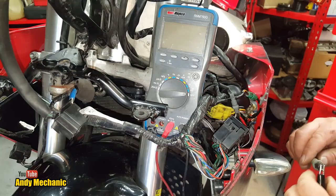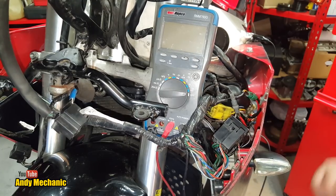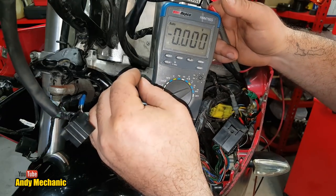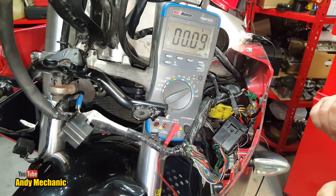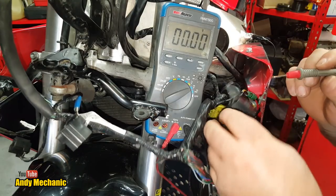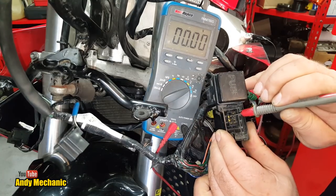Okay, let's get the earth rigged up. Stick it on there, I reckon that's a good place, if you can see that. Pop it in there so it's not hanging. Okay, meter on. You guys see that all right? Oh, you can, perfect. Range should be 12 volts, there we are, look, that should work. Right, ignition on. Hang on a minute. Maybe we'll get power, I don't know. Yes, there we go, look. Okay, cool. Alright, so we've got power on there.